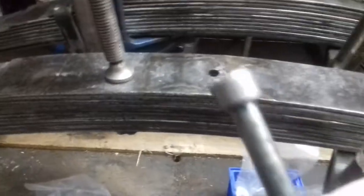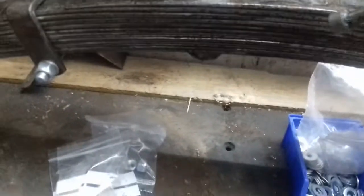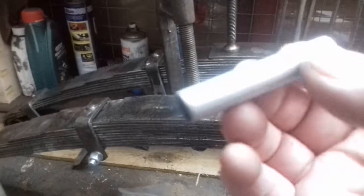I've got a new dowel pin to go in here. The spacers — which are upside down here — will be renewed. We bought a piece of tube and I'll cut them down to size and machine them on my little lathe, then give them a quick coat of paint, and they go in just like that.